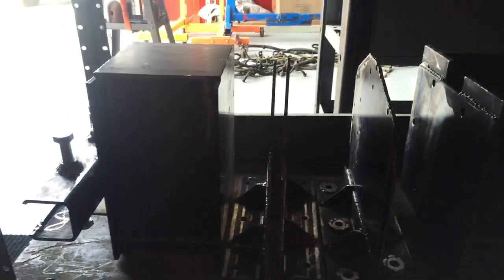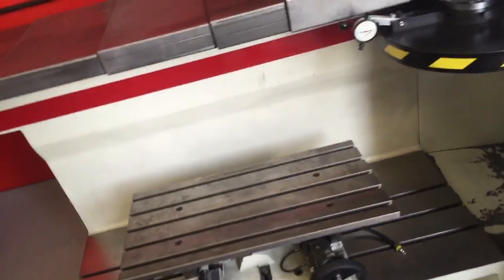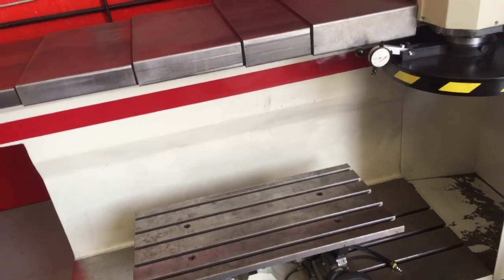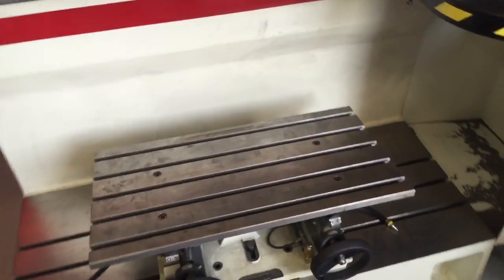Now for surfacing, I went crazy. I made fixtures for everything. Normally, Rottler has a whole bunch of brackets and bars that you have to use to surface engine blocks and heads, and it's a nightmare. I did one engine with all of their stuff, and I said, this is stupid. So I can take these plates right here, hang it from the overhead crane, bolt the plates on both sides, bolt that down to the table, adjust the table, get it level, and cut it. Then I pull it back out, take the plates off, put the other set of plates on, and do it.